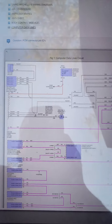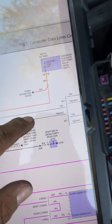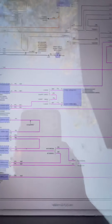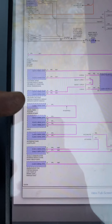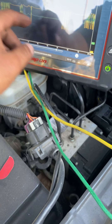I opened up my wiring diagram page, and we have the fuel pump on a tan-white wire that runs to your transmission and engine. Then there is a secondary class 2 data line, which is the purple wire — that is pin number 2 at the OBD2 plug — and then it shoots out to my BCM, and from there I have the ABS, inflatable restraint, and all that. So I knew I had to go to my scope and scope my CAN signals.